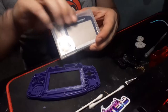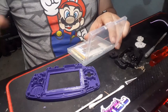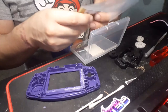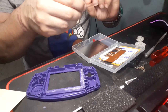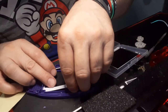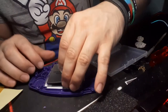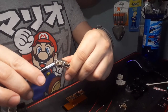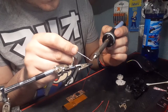By the way, I'm not sponsored at all. One of the things you worry about when you order stuff online is how it's going to be packaged, and the fact that the screen kit came packaged in its own plastic case is a nice touch. There's a bit of plastic you can adhere to the back of the screen as an insulator, and that's exactly what it's meant to be — it even says so in the little text on it. Then of course you're going to have the foam adhesive that'll hold the screen in place once you've got everything set up and lined up. The screen actually has its own PCB slash ribbon cable that attaches separately.